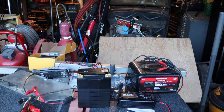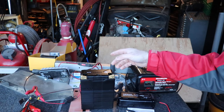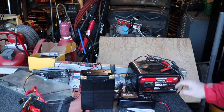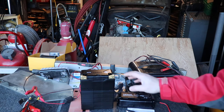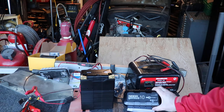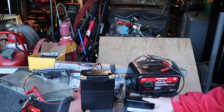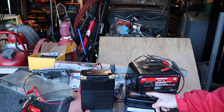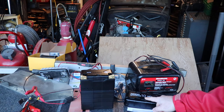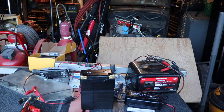Hopefully this works and is informative to you. If you're going to buy one of these batteries and you've got the old NOCO charger or a good old transformer unit, if you want to charge the battery outside of the vehicle or use it as a battery tender, you're going to have to get one of the newer NOCO Genius chargers. They have models from 1 through 10 amps — if you go above 10 amps, they might still be the old style, so keep an eye out. Unfortunately you've got to do a bit of reading before you buy. Thanks for watching.